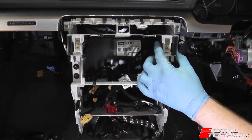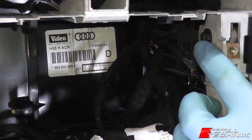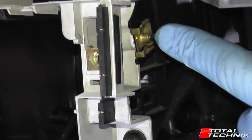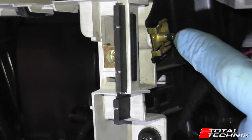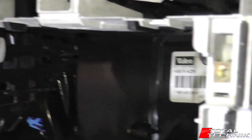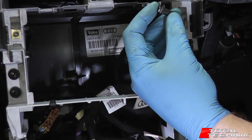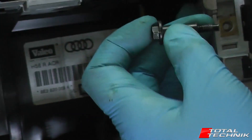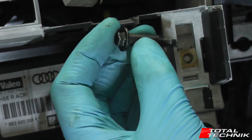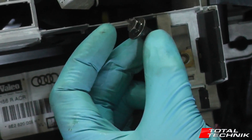What we need to do is disconnect — if you look in here, it's actually a size 8 bolt on the inside edge there. And if you look on the outside here, it passes all the way through the cage. Hopefully you can just about see that — that's where it comes out the other side through this little copper colour bracket just here. So get those two removed on both sides. As you can see, it's quite a long screw — it does pass through the actual body of the stereo cage itself, which is why it has to be removed. Remove this one and the one on the other side and we can crack on.